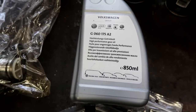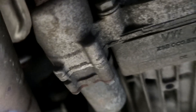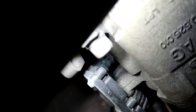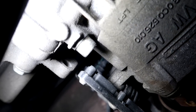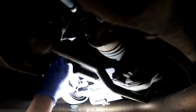This is where the pump is located. The only tricky thing with changing the pump is it has a sensor up here that goes all the way up, so the clip you need to take off is a bit tricky. You can get a better view just under here — there's a green line on it and that's the clip you need to undo. I really don't want to break that clip because it's going to cause all sorts of problems.